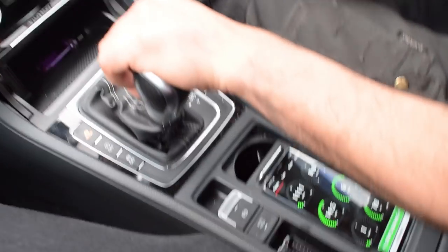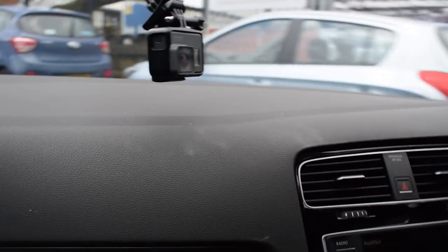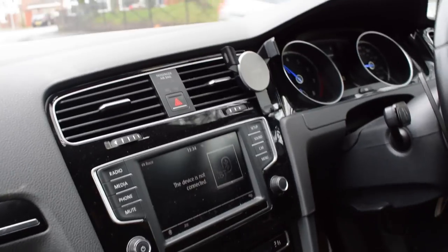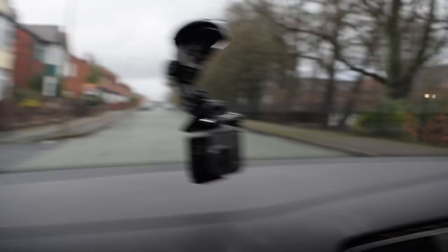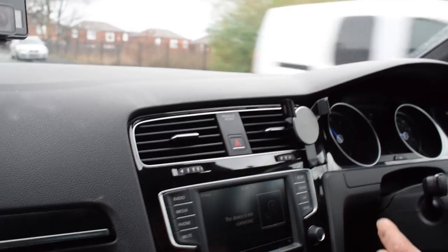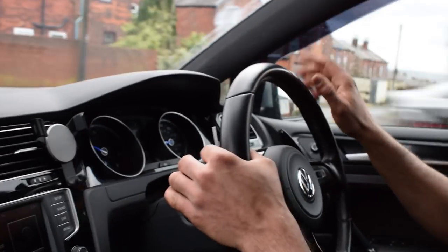We're in the car with Shaq going out on a bit of a test run. He's got the logging app running from the JB4 app. What temperature do you normally leave the oil to get up to before driving hard? About 85 onwards is where Shaq starts, and 90 and above for continuous hard driving. He notes that oil works more efficiently when it's hot because the viscosity changes — a lot of people start panicking when oil gets hot, but it only starts degrading above around 125–130 degrees. The optimum temperature is around 100–110 degrees.